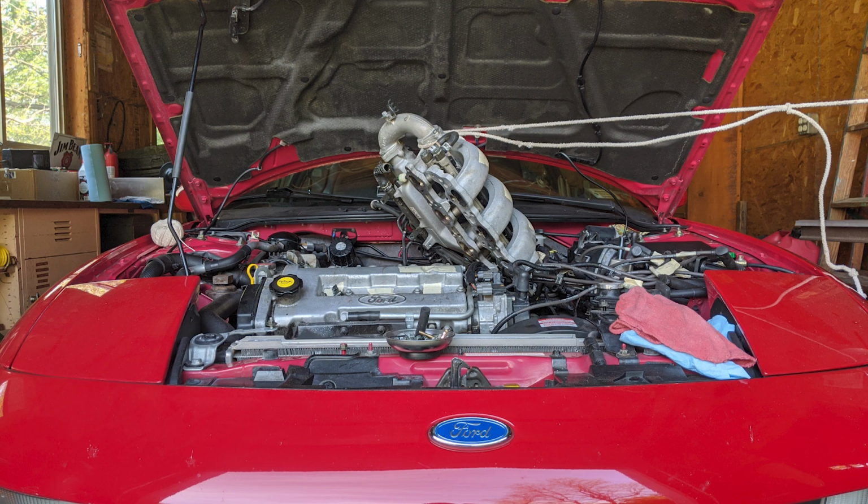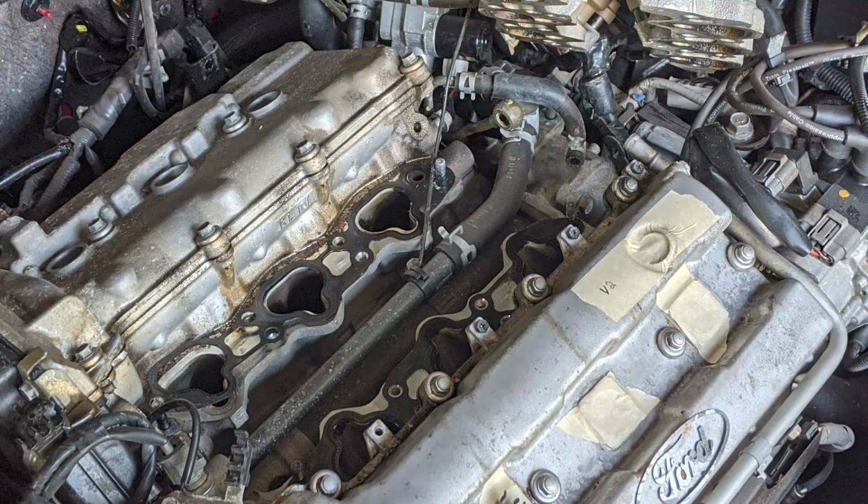The throttle body is sitting in an area where the air system used to be. This was able to keep it in place while I removed the valve covers. With the intake manifold safely supported, ball up some shop towels and place them in each of these holes. Do your best not to disturb any debris yet, since you don't want anything falling into the holes.